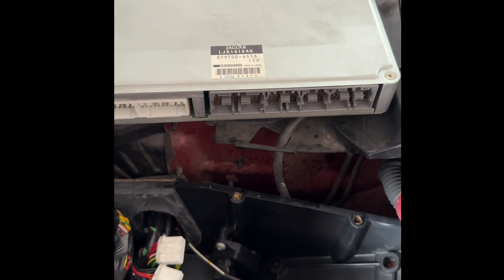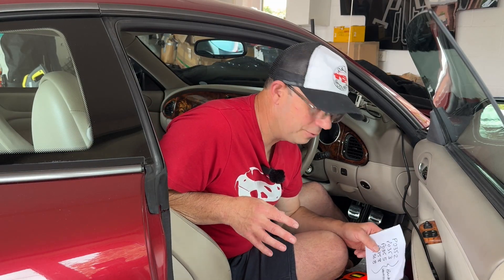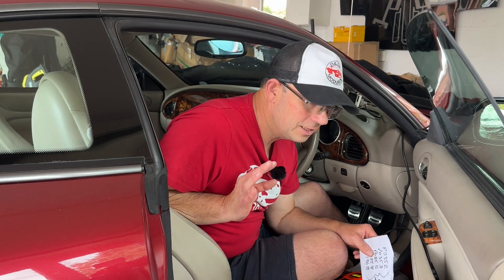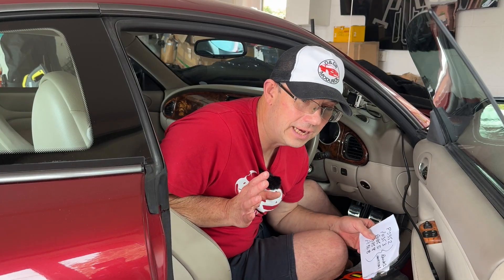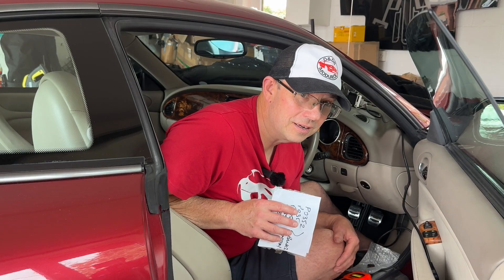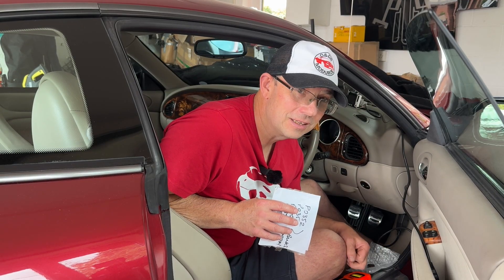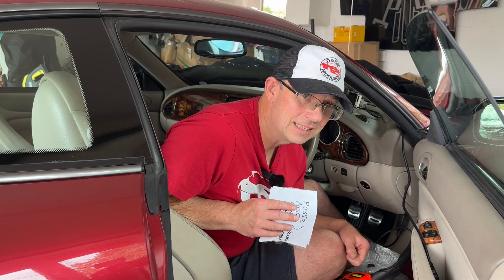So that's how we repaired our ECU. There were capacitors showing clear signs of wear, so it was obviously worth doing. I have started the car and it runs fine, so we haven't broken anything. Only time will tell if the heat-related issue is still there — I need to take it out for a run and hopefully, fingers crossed, it won't reoccur. But either way, those capacitors did need changing.